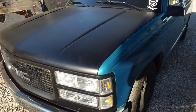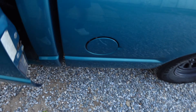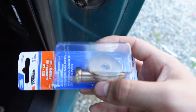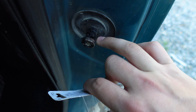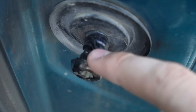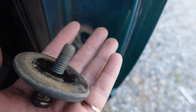So here's the truck — so dirty, I just washed it barely a couple days ago, it's from the field, all the dirt just comes right in. This is the part I'm going to be changing right here. I'm not sure if I need to keep the back piece or not. It just takes an allen wrench — this is called the door striker. Mine's all messed up, I have electrical tape on here just to hold it because my door was bouncing around.